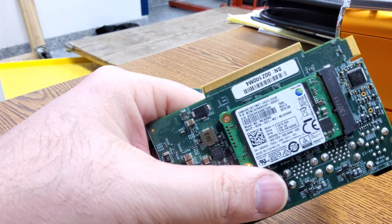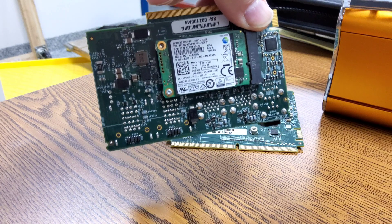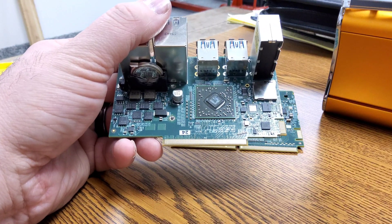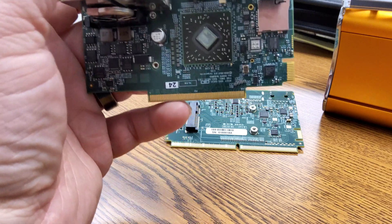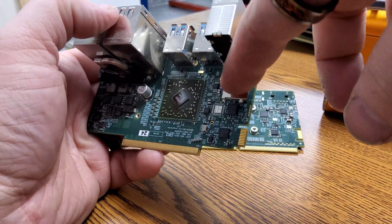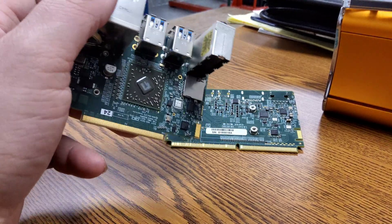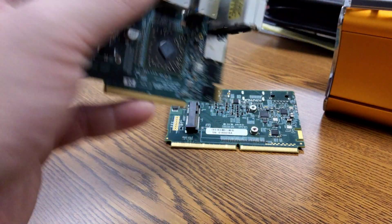The next board has another mini PCIe express style slot. As you can see, we have a little Samsung SSD - it's a 256. On this side we have our battery and our southbridge chipset, which is way too small for me to read. It also has a micro SD card slot internally, so you can throw a tiny Linux distro on it for diagnosing problems or any Linux distro that loads into RAM.